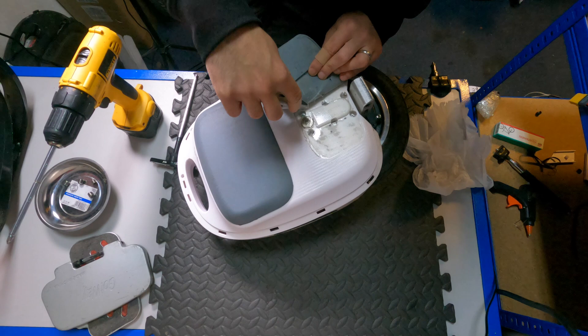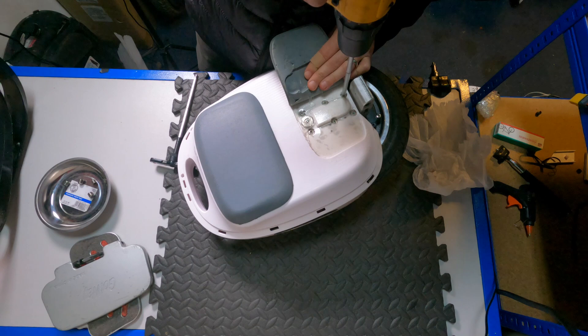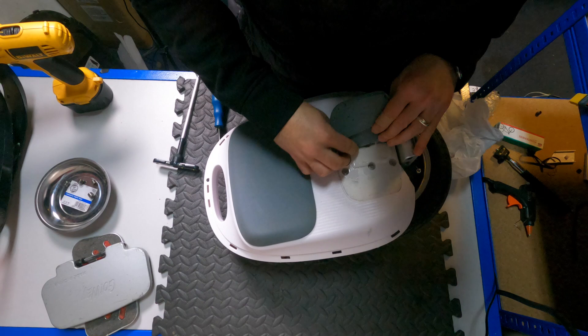You may find a membrane, so you need to pierce it before you can have easier access to the screws. Also worth noting that the magnet used to hold the footplates together sometimes also attracts the metal screw bit, which makes removing the top screws slightly more challenging.